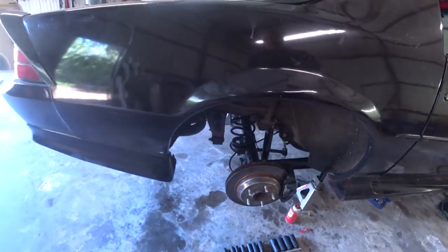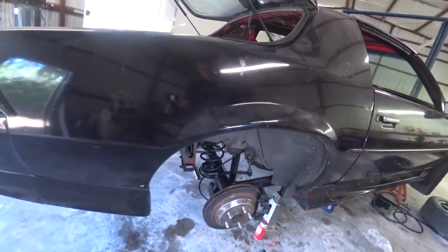Now that I have the rear end all the way in, I have the torque arm in, the transmission in — I have all this stuff. I've got to bleed the brakes to test these brake lines. It's just me, so hopefully I can do it. Hopefully they don't leak. I just pray they don't leak. Standard brake bleeding — I'm going to start on the farthest away, which is the passenger rear. Let's get started.